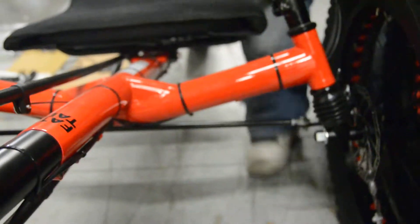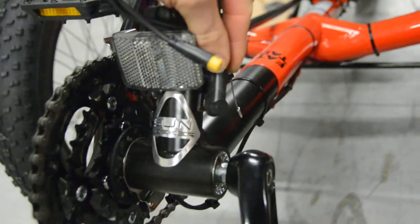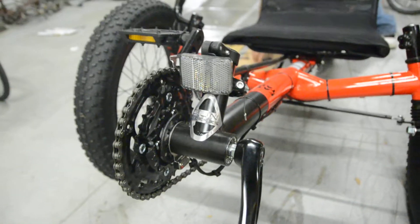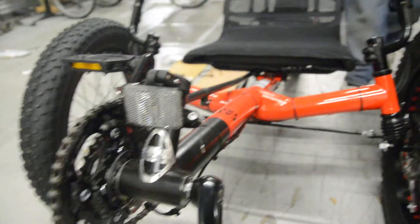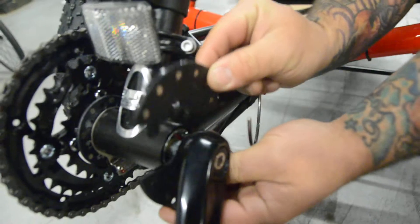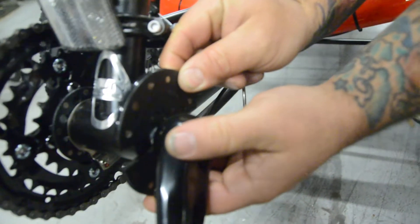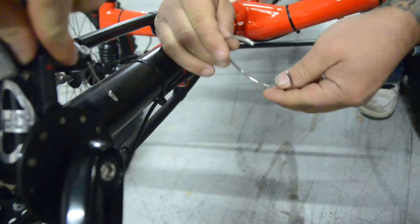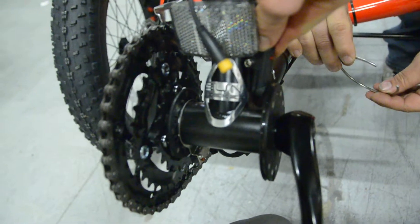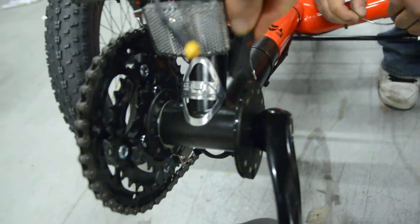On most bikes when you're setting this up, you'll pop the sensor over here near the front derailleur, stick it on, and put the magnet disc right in here, and then you'll be able to use the pedal assist. Jeremy is going to show us quickly — we have a separate video where you can see how it works. You just pop the disc together, then put the circlip on afterwards and stick the sensor down in here. Then you run the cable and the extension, and you have a really quick and easy pedal assist setup.